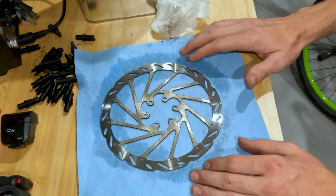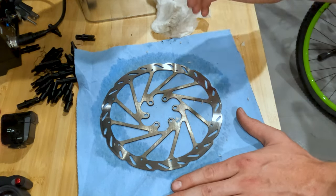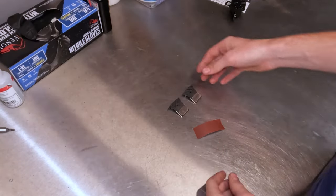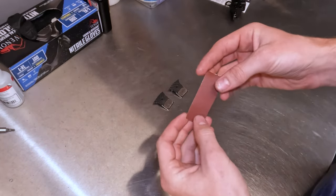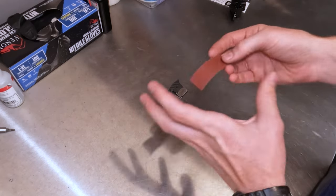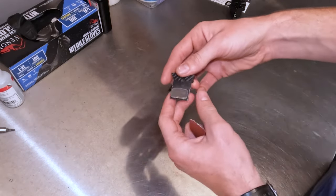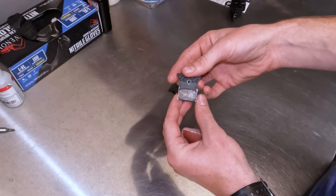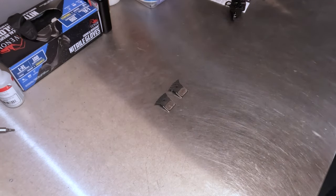That's how you decontaminate your brake rotor. Now we can chuck it back on the wheel and bed them in. After you've decontaminated your rotor, you're going to want to decontaminate your pads. It's pretty simple — all you need is your pads and a little piece of sandpaper. Grit doesn't matter too much, anywhere from 100 to 320. You just want to rough up the surface and get the glazing off if they are glazed. These are not quite glazed but not quite fresh either, and we want to take them back to that fresh state.